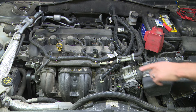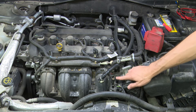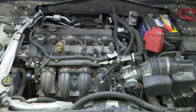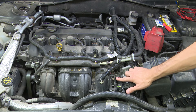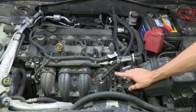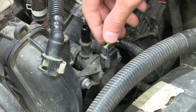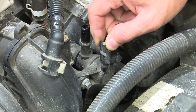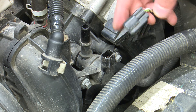Now I want to start up the engine and see if we have leakage on the purge solenoid. A purge solenoid is meant to be normally closed, so we should see no leakage. You can just put your finger over it — you can hear it as it tries to suck your finger in. You always want to verify the computer isn't turning the purge on, so go ahead and disconnect the electrical connector: push in on the tab and pull up, always grabbing the connector by the connector body, not by the wiring.